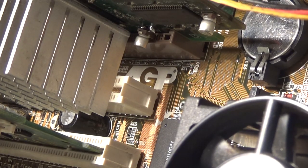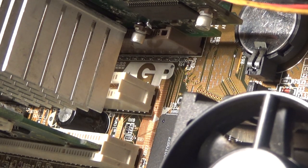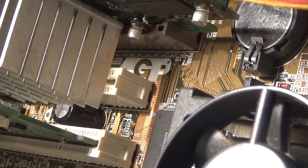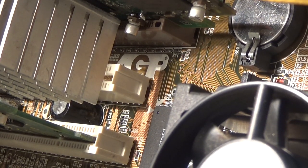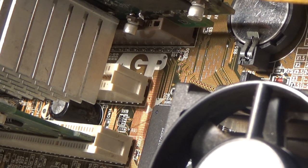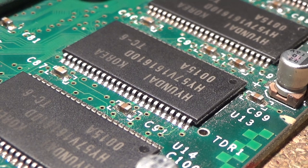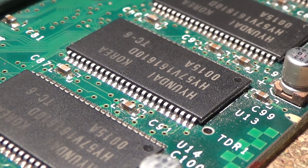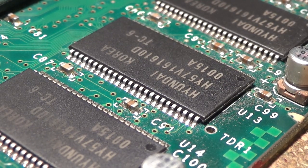It actually uses the AGP bus as well, instead of bottlenecking the shared parallel PCI bus all the time. It integrates everything into a few components, largely one big ASIC, and a RAM DAC. Hell, I think some of them even integrated the RAM DAC into the ASIC. Who would have thought? In case you're wondering, the RAM on the card is SDRAM, and there's 16 megabytes total. It can't be upgraded, but hey, that feature was gone from most cards by this point.